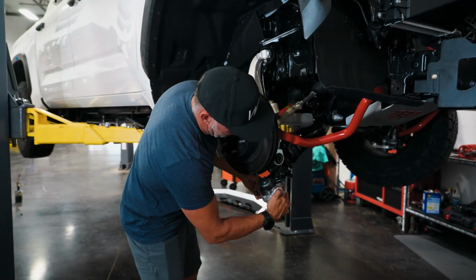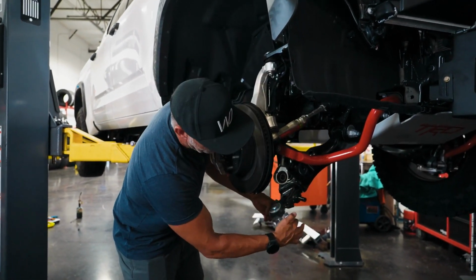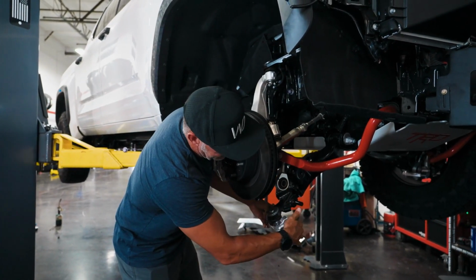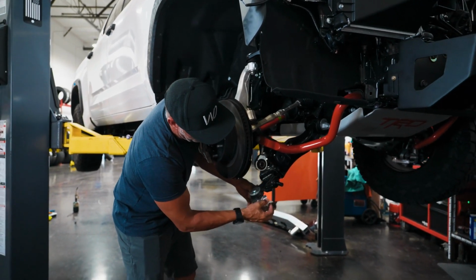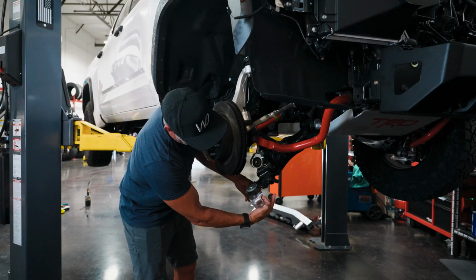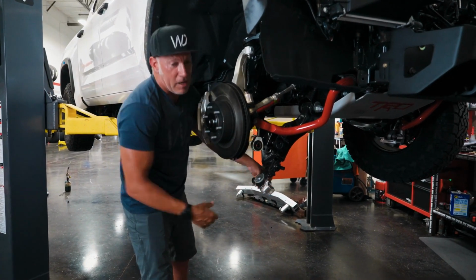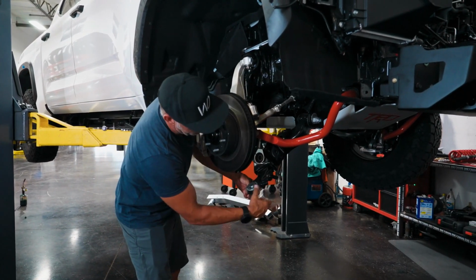So when it goes and makes contact here on the lower control arm, because the lower control arm is steel, the two surfaces, obviously the aluminum is much softer than the steel, so it's not gonna gouge into it as it did in the earlier models. And that was because this window wasn't as large. So it was actually rubbing up inside of here. So Toyota has gone ahead and they've made this change. This is standard on all the model Toyota Tundras now for 23.